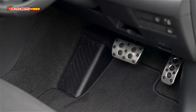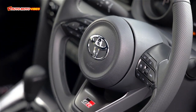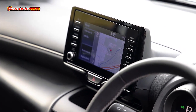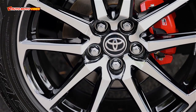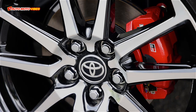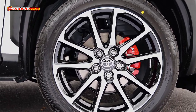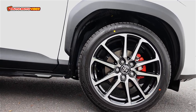At the rear, a groove washer bolt evens out surface pressure on the suspension fastening bolt and improves rigidity at the joint for greater steering response. The Yaris Cross GR Sport is powered by a 1.5-liter hybrid powertrain pairing a 67kW, 120Nm 3-cylinder petrol engine with a pair of motor generators on the front axle to produce a combined system output of 85kW.